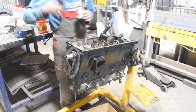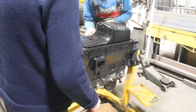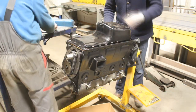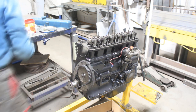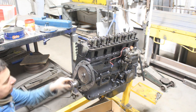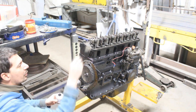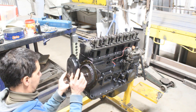I didn't forget that the oil sump was held only by two screws, so I turned the engine upside down, smeared some gasket maker on the surface, installed the gasket, put the sump, and with the help of Jake I closed the engine. This is my proof that Jake was part of the rebuilding — if anything goes wrong, it's his fault. The rest of the engine assembly is pretty straightforward and doesn't need much explanation, except here this oil deflector is another brand new aftermarket part that doesn't fit, so I have to file it a little bit until it fits on the crankshaft.